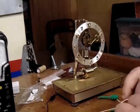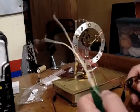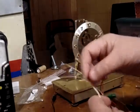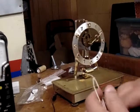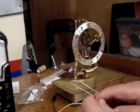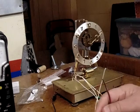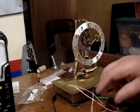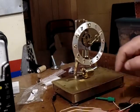If you look at it, it's pretty simple. It has four wires. It has your power, which are black and your red. And then your two signal wires that are just two plain white ones. It doesn't matter how you hook them up, except for the power of course. So either wire will go to the coil.